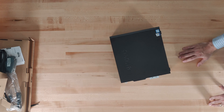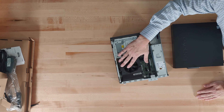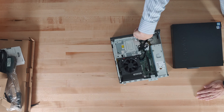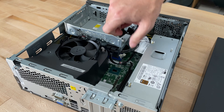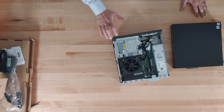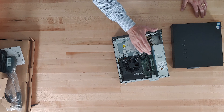Some people have asked if I could open the units as they're curious to know what's inside, so I'm going to go ahead and open it quickly. Inside you'll find the CPU has a cooling fan on top of the heatsink. The memory is underneath this bay here, and the NVMe drive is completely towards the front. You could easily increase the memory by adding it in the empty slot. Regarding the power supply — one question I get is whether you can change it and put something larger in there. As you'll notice, this is a very small power supply, and you can't really go out and get a third-party replacement — you'd have to measure this and make sure whatever you get would fit this case.